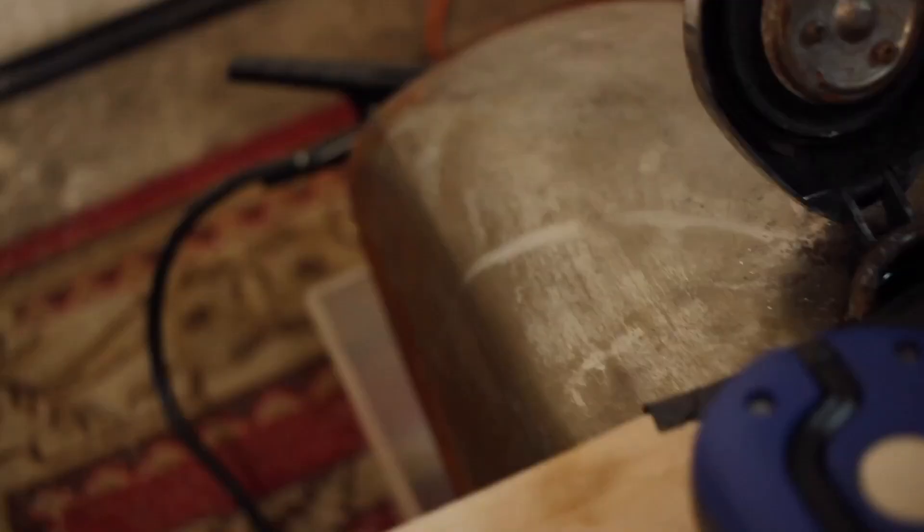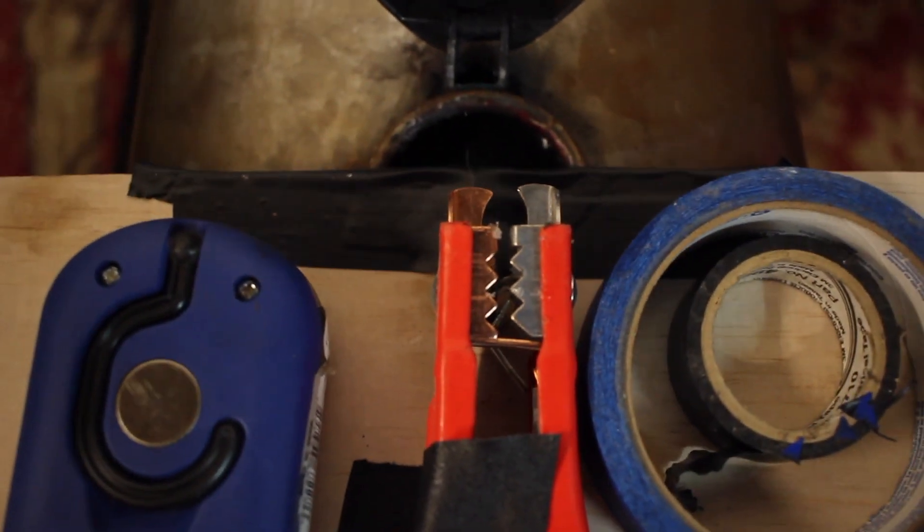And it's really that simple. You can also do this entire process within the gas tank itself, and I actually did that with the KZ tank. I did have a little trouble there with an old gas tank liner that was still in there, so I had to take care of that. And then I gave it another go with the electrolysis setup.